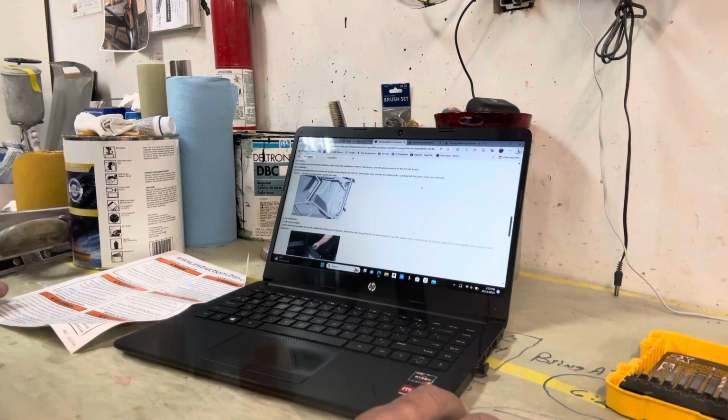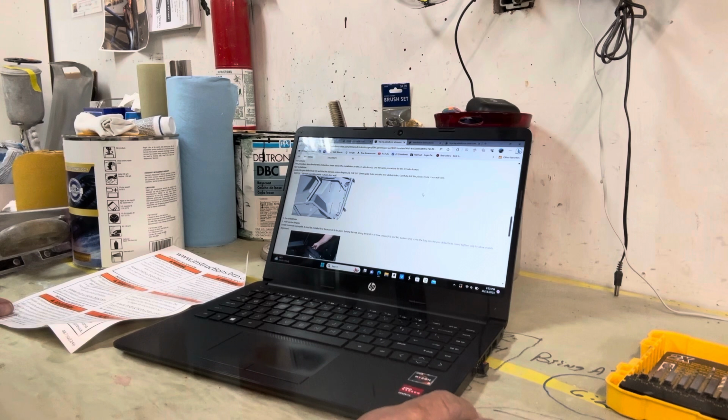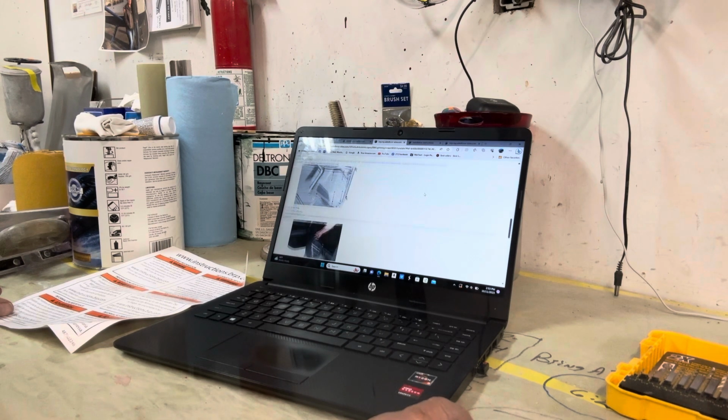The procedure described in this instruction sheet shows the installation on the left-hand side door. Use the same procedure for the right-hand side door. Prepare installation, locate the pre-drilled hole and 5 hole center dimples. Drill an 1/8-inch pilot hole into non-drilled holes. Carefully drill the plastic inside door wall only. Do not reach the plastic outside door wall. As you can see, do not drill all the way through the door. You're gonna have a hole on the outside of your door.